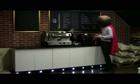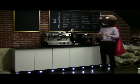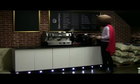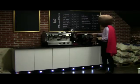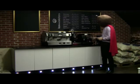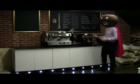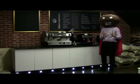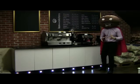So what have we got to stop that from happening? We can set a differential on the machine, so we can find out the temperature here and set a differential, so that essentially what we see on here is the temperature that is coming out of the group head. And that can be calibrated on your machine. We can do that for you if you ask very nicely.